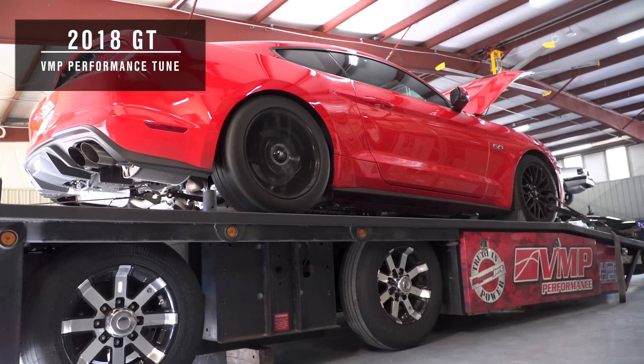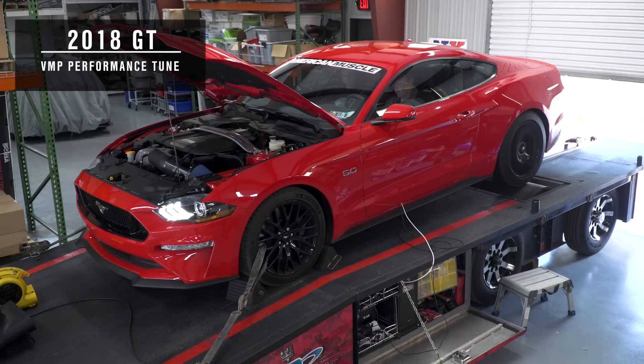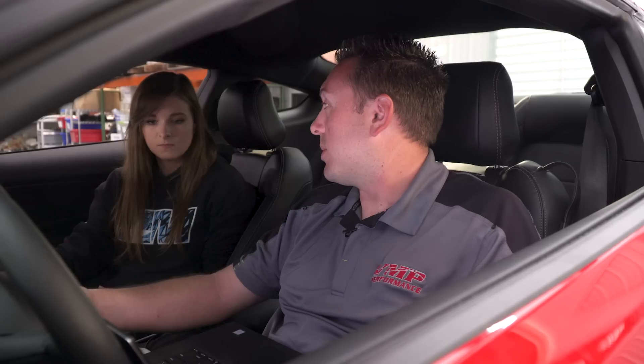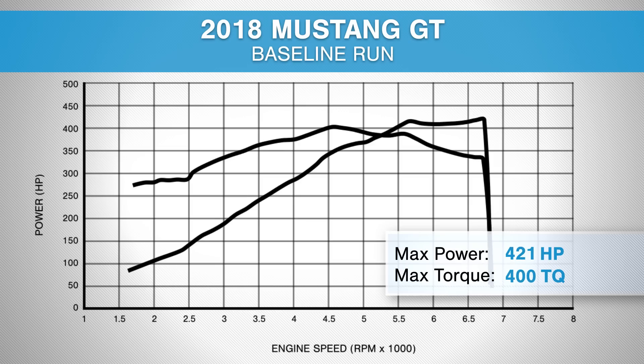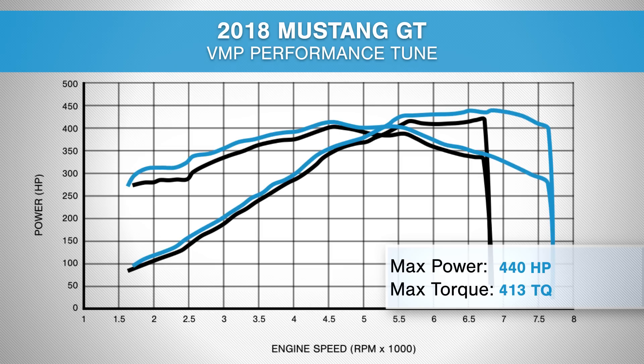We just loaded our first tune and we're about ready to run the car and see what kind of power we get. After a couple of runs with the manual on our first tune — when you're on the dyno you want to run the vehicle in the one-to-one gear, and in the 2018 Mustang with the manual trans that's fourth gear. The baseline was 422 rear wheel horsepower in one run and 421 in another. That's just awesome for a stock Mustang out of the factory. We ended up seeing between 17 and 18 rear wheel horsepower gain and about 8 to 10 foot-pounds of torque gain. The big thing is the area under the curve — we picked up power down low and up high.